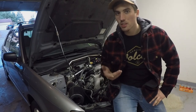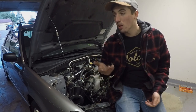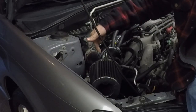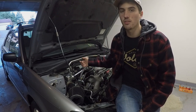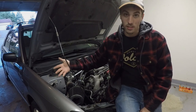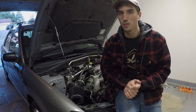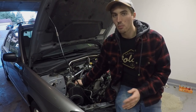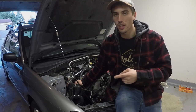The reason you need to use a bypass valve with a mass airflow sensor regulated car, as opposed to a typical blow-off valve, is because the mass airflow sensor — which is right here — regulates that air. It goes through the turbo and into the engine eventually. If you're blowing off that air into the atmosphere, it's going to mess up the pre-measured measurement by the mass airflow sensor. So you need to route that air back into the intake pipe manifold after the mass airflow sensor. That's important because you don't want to measure that air twice — it's got to go after the mass airflow sensor.